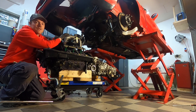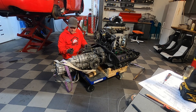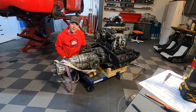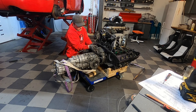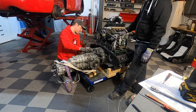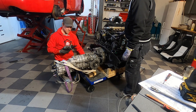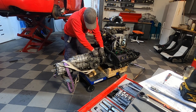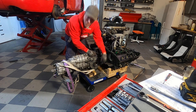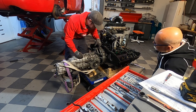Since this project is about taking the C4 out, we better get rid of this big chunk here so we can compare this with what it would be if we didn't have a C4. So the starter needs to go off first. With the harness off, we can get the starter off — and here we go. Before they separate, we need to take the clutch shaft out — it's this little bolt just here. There's a little cover here covering this clutch shaft. If you take it out and just put a little bolt in there, then you can use that to pull it out.